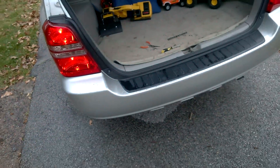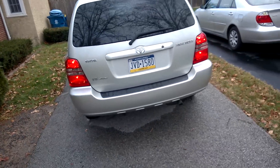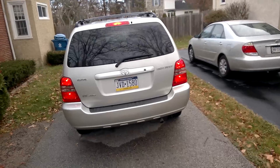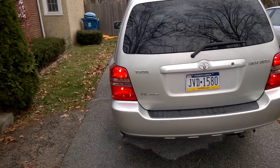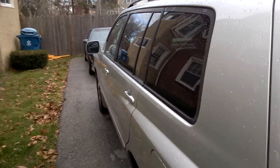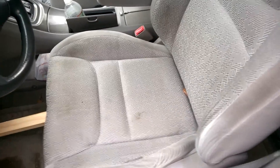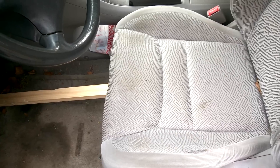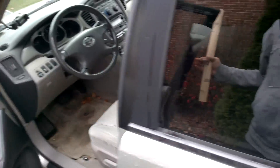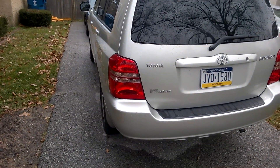I think that probably has it fixed. What I'll do is go back in there again with a nail file or something and clean the contacts a little bit better and bend things up. But that's basically what you've got to do to get that to work. So before you spend $150-$160 at a dealership for them to look at it, and then tell you they want a few hundred bucks for a new tail light assembly and another few hundred for a wiring harness — do what I just did. See if that fixes it, because I bet those two bulbs I took out of there are still good.